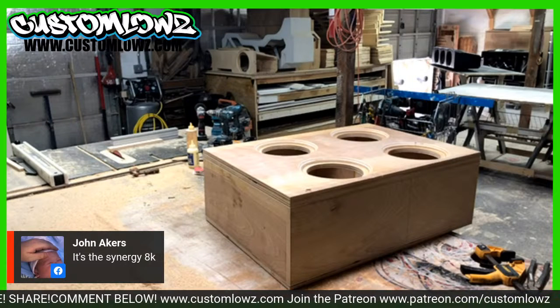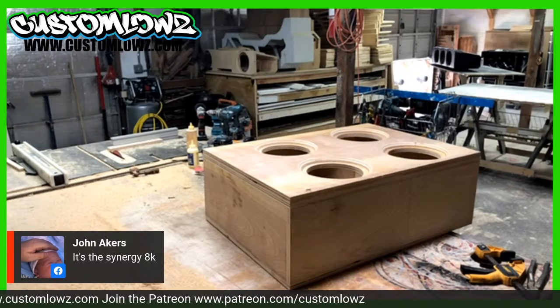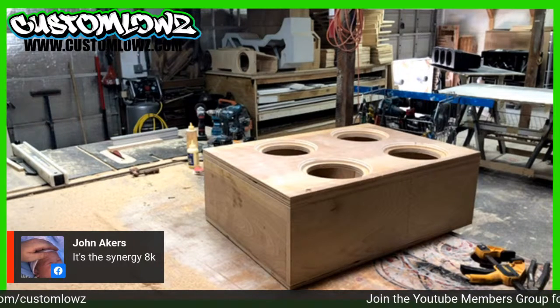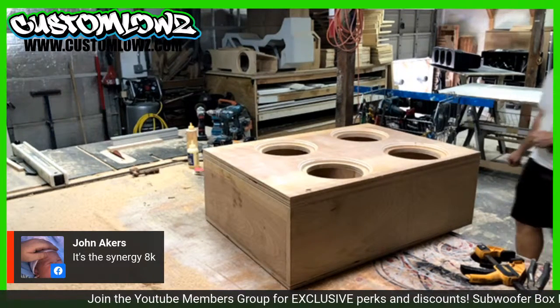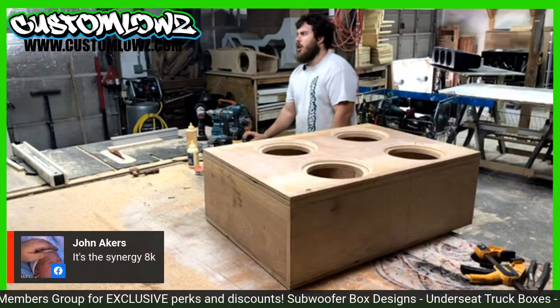As long as you're on normal, I guess there are more questions you could answer to that also, though. Are you on 14.4 volts? You know, what are you trying to charge at? Also, I would suggest definitely getting a high output alternator, do the big three, and make sure you're running good quality OFC wire.